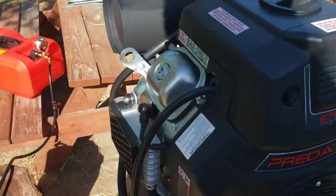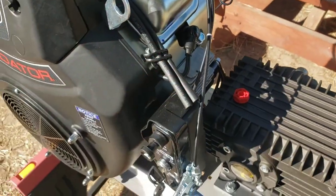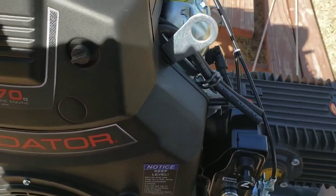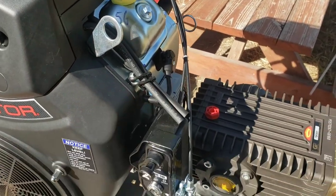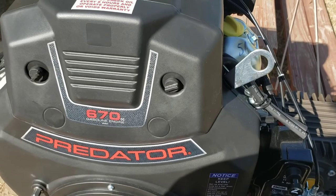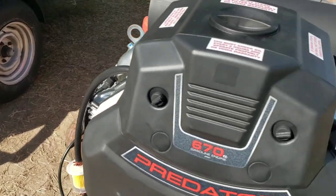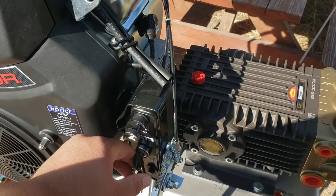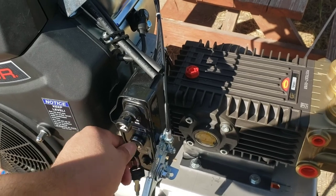I am gonna get an hour meter to put on this thing. Gotta wrap it around the coils. There's just so many bad reviews with all of them, it's just hard to actually pick one. You got some that work off of induction with you wrapping a coil around the spark plug. There's some that work off of the vibration of the motor, which I think, depending how that works, it may be skewed with, you know, being on the trailer or truck vibrating. You have some that run off the on switch, so when you have it on, even if the engine isn't on, it'll start clocking time on it.